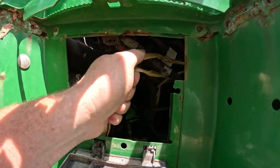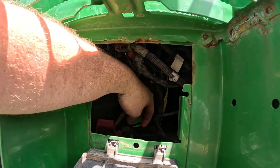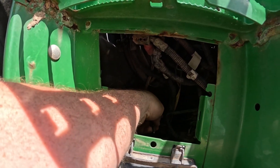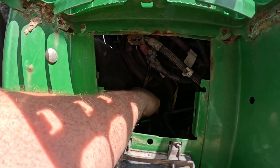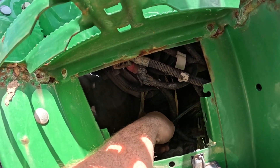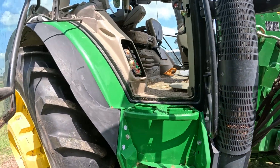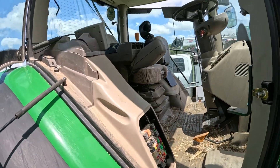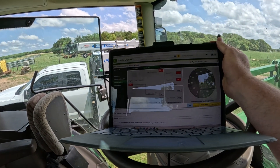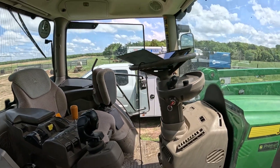I looked in here and wiggled the positive and wiggled the negative. When I looked, this wire was just barely sitting there — it wasn't even making contact anymore. I started messing with it just a little bit and all of a sudden I could hear the display start beeping at me. When I did that, my CAN volts just started going nuts and the error rate started jumping like crazy too. So we've just got a bad connection — the eyelet on that terminal has broke off pretty well.